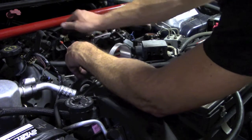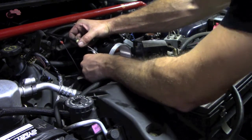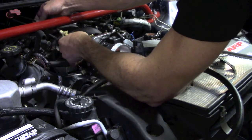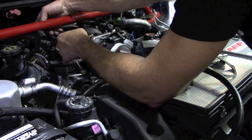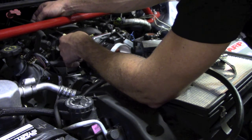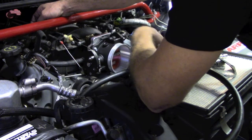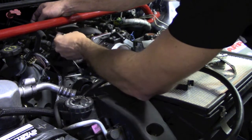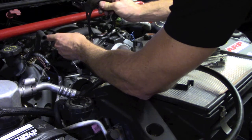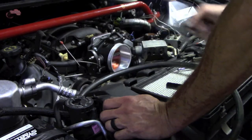The throttle cable does need to come forward, because as it drops into place here, placement doesn't lack much. It's kind of hard to tell where that gas pedal is going. It's about right there, so we only need an inch. Which it looks like we'll gain exactly what we need with this adjustability. So, thanks Phitek for recommending that. We're going to use it.